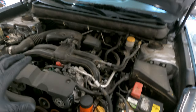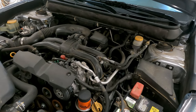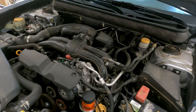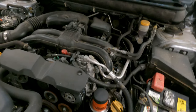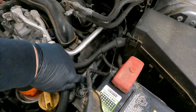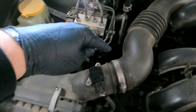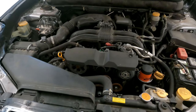The way this motor is situated, it's a boxer motor that is horizontally opposed — so it's not a V and it's not straight up and down. The cylinders actually shoot side to side, parallel with the ground. The spark plug locations are on the sides of the motor here and also on this side, so it's kind of difficult to get to them, but I'm going to show you a trick to get a little better access.